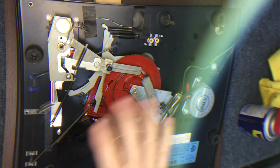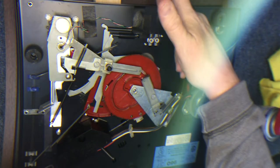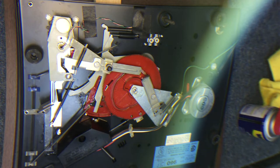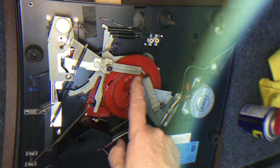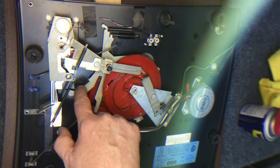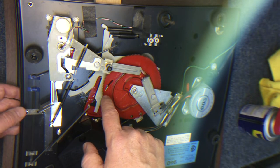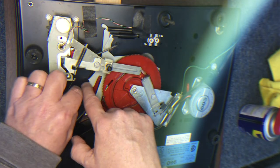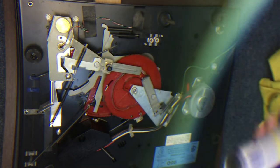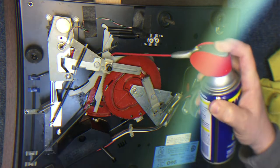As it turns out, you don't take the bottom of the base off — you take out a couple of wing nuts and the whole mechanism just pulls out of the base, kind of like BSR style. Looking at everything, I have worked on a couple of these back in the day. Seems I remember this over here being kind of an issue as far as where the arm drops on the record for 33 or 45, and this seems to be corresponding with our speed switch. These are feeling a little gunked up. I'm going to take a little WD-40 and drizzle it in there and see if we can get it to loosen up the way it's supposed to.